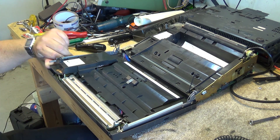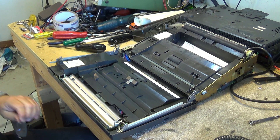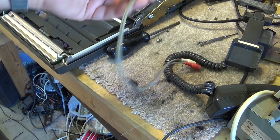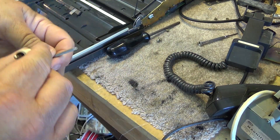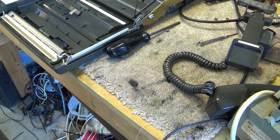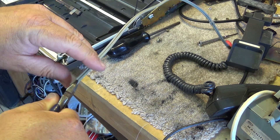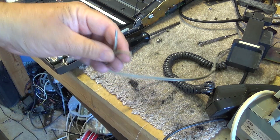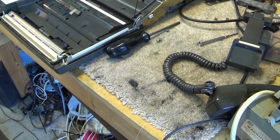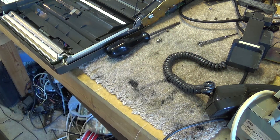So let me prep the audio cable I'm going to attach to this. Whenever I've made a custom cable for something and cut an audio cable in half, I always keep the other half because you never know when it's going to come in handy. This is just one of those instances where I can take the second half of a cable I used before for another project, open it up, connect it to this unit, and use it as my audio out cable. I can even put both of them together so I have a stereo output, even though this is a mono machine — I can put it into both channels on my recorder.